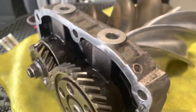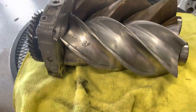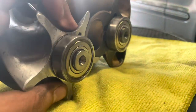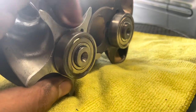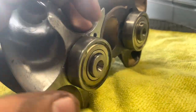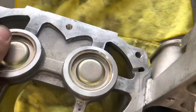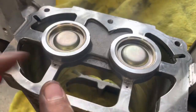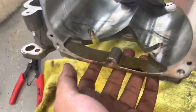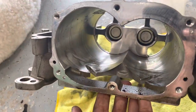The rotors are out on the C32. On the C32, the bearings come out with the rotors. On the E55 the bearings stay inside the housing, and you don't have these caps here, so all you have to do is pull the rotors out — a lot easier. But as you can see, it's pretty dirty but it is out.